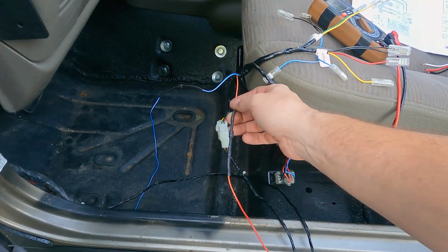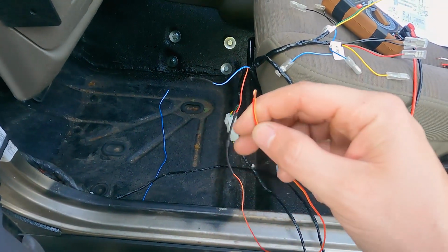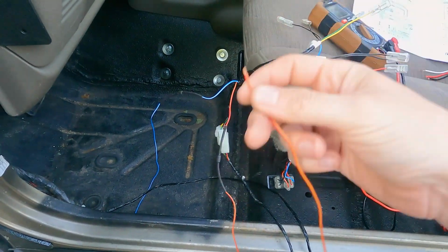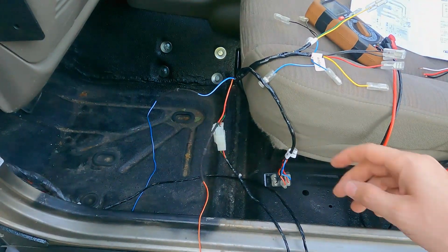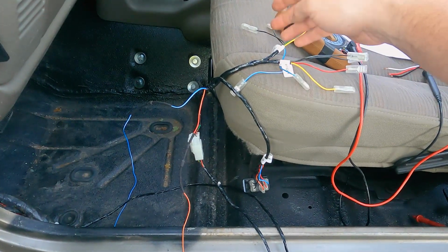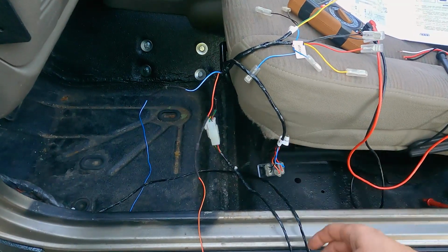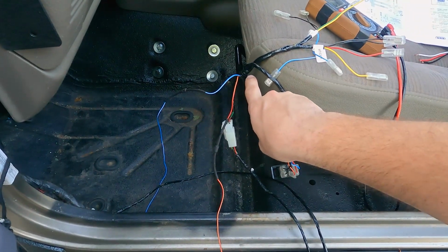The red and yellow wire, on the other hand, is what will get 12 volt power. So you will connect this to constant 12 volt power or auxiliary, so once you turn on the Jeep, it gets 12 volt power, like an ignition switch. And then this wire, once it gets power, feeds your power wires in each one of the switches, switch 1, switch 2, and the isolation switch. So that way you don't have to run power to three individual switches. They've got it spliced in here for you.